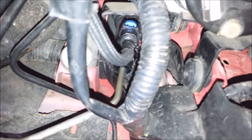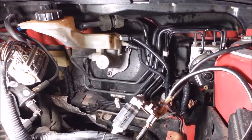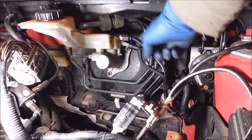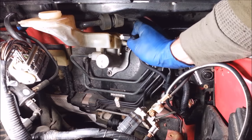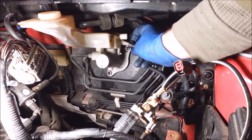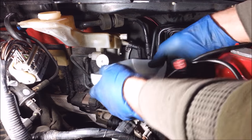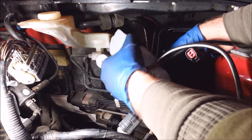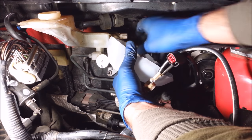There's the master cylinder for the clutch, buried right there. The brake fluid reservoir for the brake master cylinder is using the same reservoir — there's a little line that runs into it. I'm gonna unplug this sensor; there's a little button you push in and pull it out. I'm gonna put some kind of tray under here because this is going to make a mess.